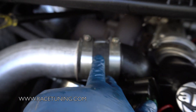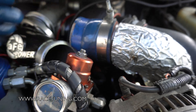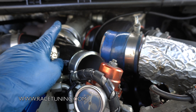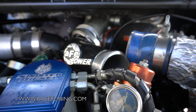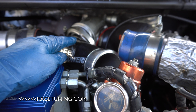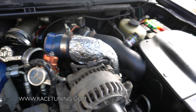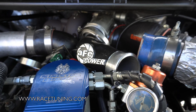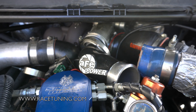The exhaust side fits pretty decent right here, but I've had the intake off several times trying to get the stock boost tube to line up. The stock boost tube lined up perfectly with the stock spider intake, but with the AFE I still haven't been able to get it right. This is probably the third time trying. I think when it's done you'll see it's still gonna be off. I don't think this part's really gonna give you any noticeable power increase — all it's really gonna do is take your money — but I'm gonna work on it and see what it looks like.